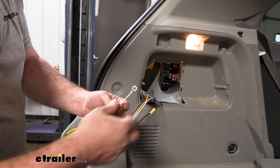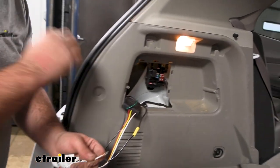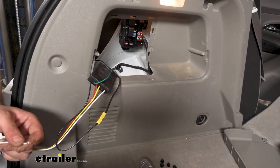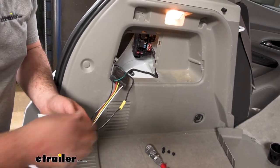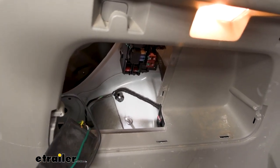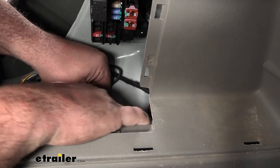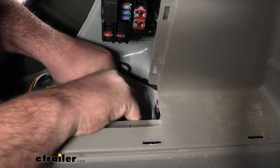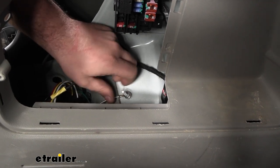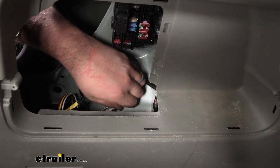We're going to attach our ground wire on the driver's side — the ring terminal is attached, and it does have a flat side that you want against metal. There are a bunch of studs here that you can use as a factory ground, but you will need to pick up a nut to thread that on. Your other option, which is included in the kit, is a self-tapping screw — find a spot where there's no wiring, scuff that area down to metal for good contact. I'm going to use the stud here. Tighten it down — you don't have to crank it, but make sure that ring terminal is not going to spin around.